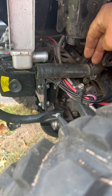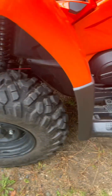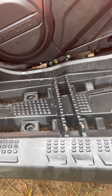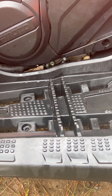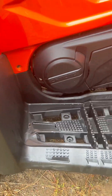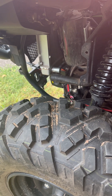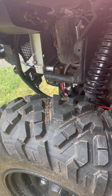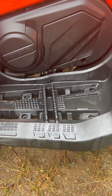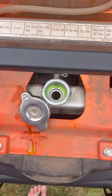Make sure that's empty — which it is. Because earlier I pulled this off, that bolt, and it drained out of there. But if you want to have a little easier time, because it did kind of come gushing out, pull that bolt off first and let most of it drain out into a bucket. Then — not like I did — take that hose off. And as we can see, the radiator's empty.